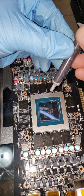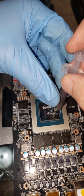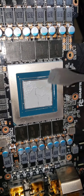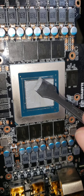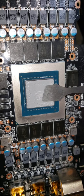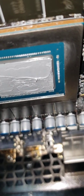Something I think other videos didn't cover very well is how much thermal paste to put on. I'm going to show you how little I use — just enough to cover the metal but very, very thin. There we have it: completely covered but very thin, not so much that it's going to pile on the edges. This is really high quality thermal paste so you don't need a whole lot. Leave a little bit in the center to smear out when it touches the copper plate, but very thin — don't overdo it.